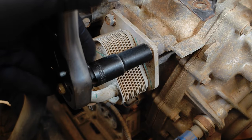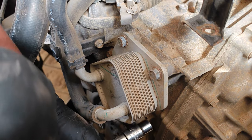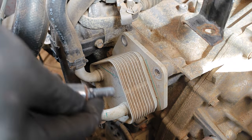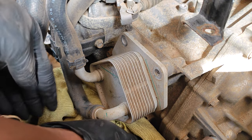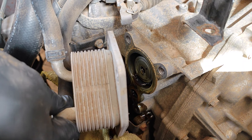The warmer is held by three bolts — two you can see here while there's one beneath which I mostly do by feel. I break the two at the top free and also follow up by taking out the third one. Some fluid is going to spill, so I move in my drain pan and tuck a rag beneath the transmission warmer, and finally with a gentle tug the warmer separates from the transmission.